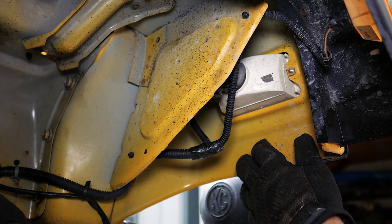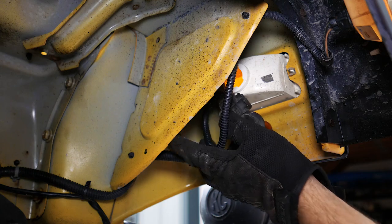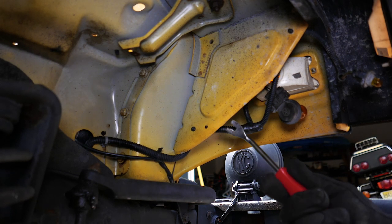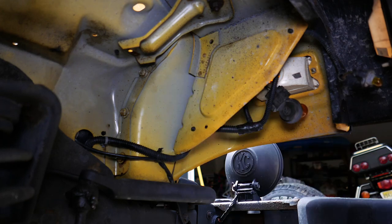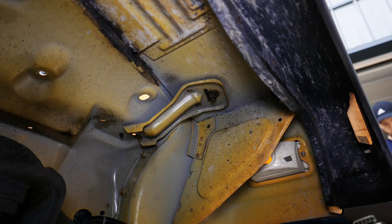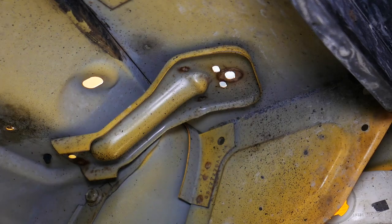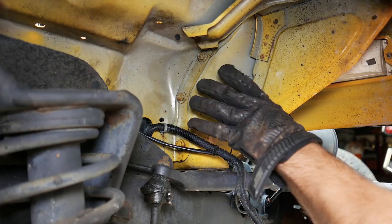There are two lights attached to this fender. We're going to need to take the lights out so that the fender can come off. These plastic clips are also attached to the fender for the light harness, so pop those out with your tool. Then we can start removing the bolts that hold the fender to the Jeep. There is a 13mm nut here that holds the latch for the hood up on top.